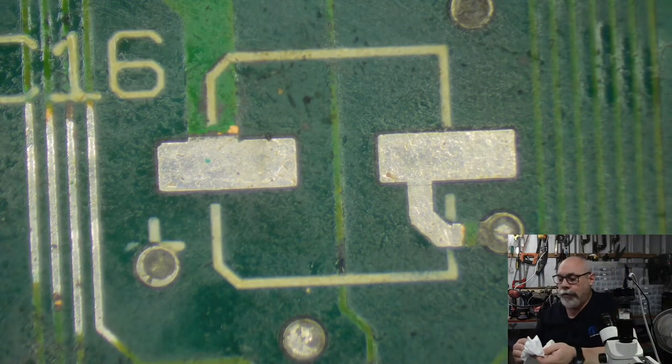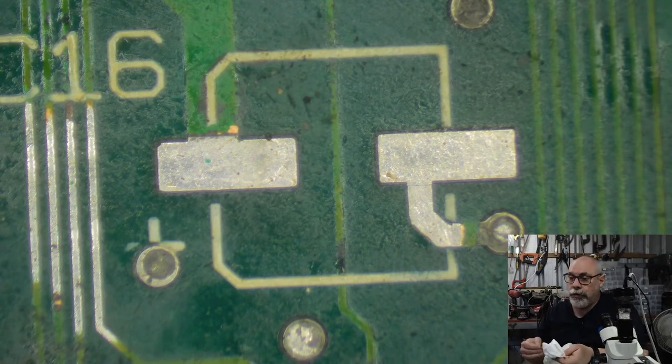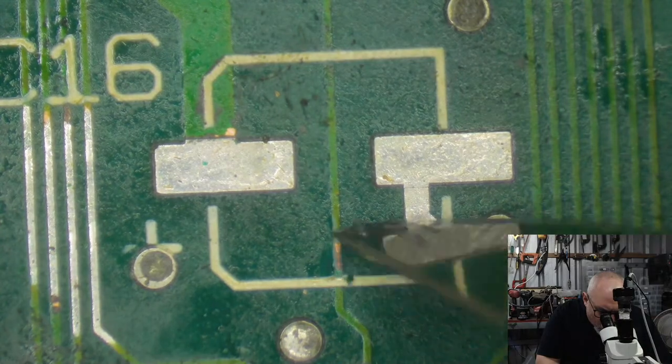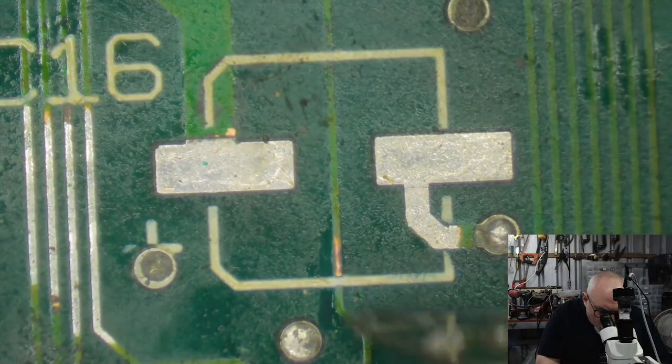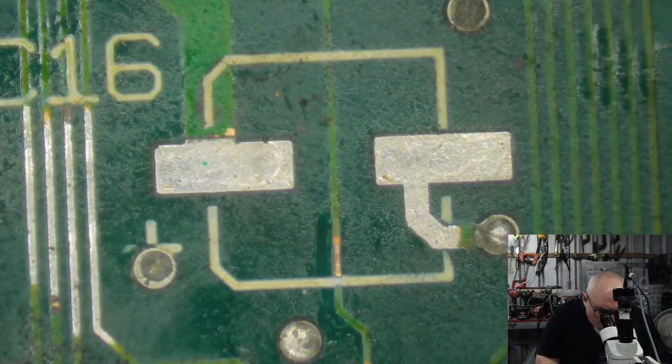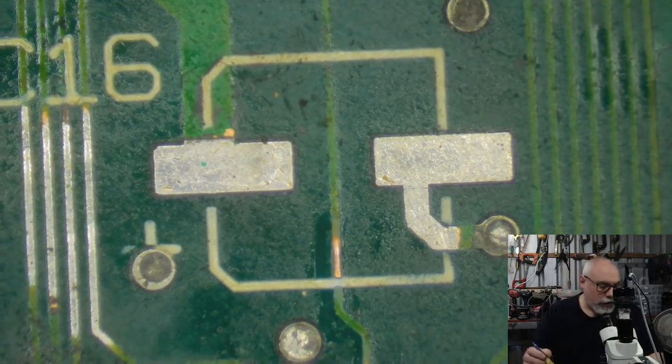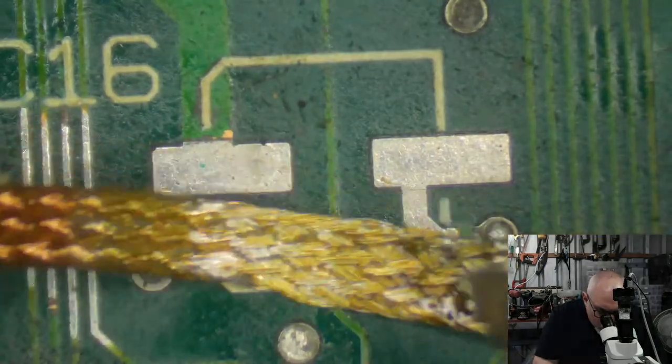And then of course, once you have done all those things, if you're still not getting sound, the next thing you need to do is check if you get sound through headphones. And that just helps you isolate whether the issue is the sound chip or potentially the amplifier. So anyhow, that's it. I've said my bit.